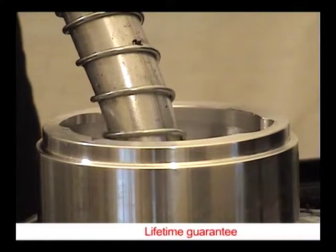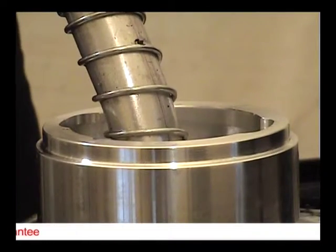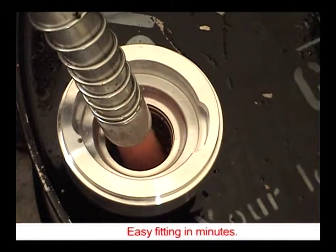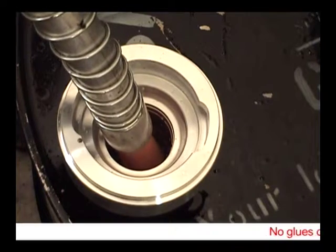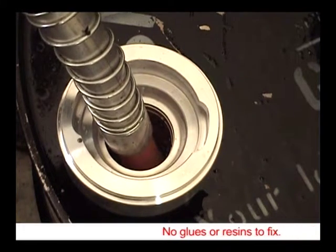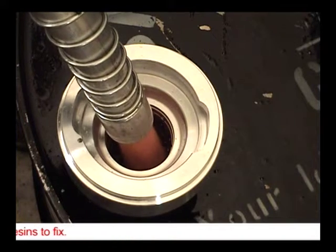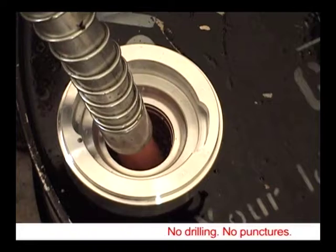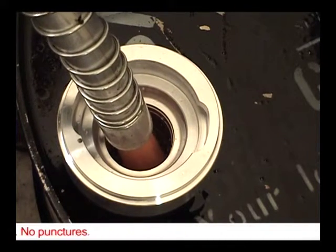If you use chains to retain the fuel cap, trim the chain length to 10cm. This will ensure that the chain will hang in the basket rather than lie in the bottom of it, and avoid the possibility of any of the links snagging. Attach one end of the chain to the fuel cap and the last link of the trimmed chain to the Neckit by passing the roll pin through the hole in the Neckit and the last link in the chain. Having done this, simply replace the cap in the normal way.